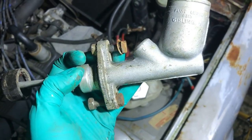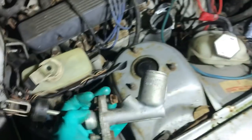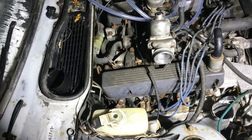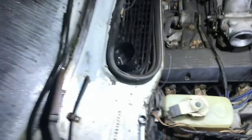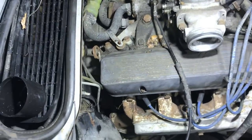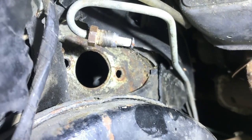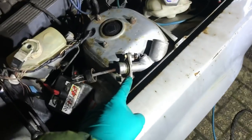It doesn't look that bad, but you never know until you've taken the insides out. What is good is that the metal pipe going all the way down to the chassis rail is in really good nick. What's less good - but kind of expected, as all manual SD1s seem to do this - is that the bulkhead is actually cracked. It's not rotten like the blue car, but there is a crack there which will need to be welded up and then ground smooth again, and then I'll rust treat that whole area.